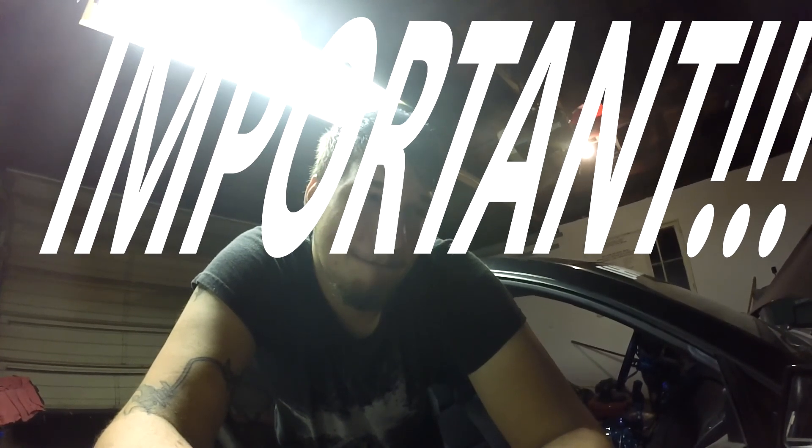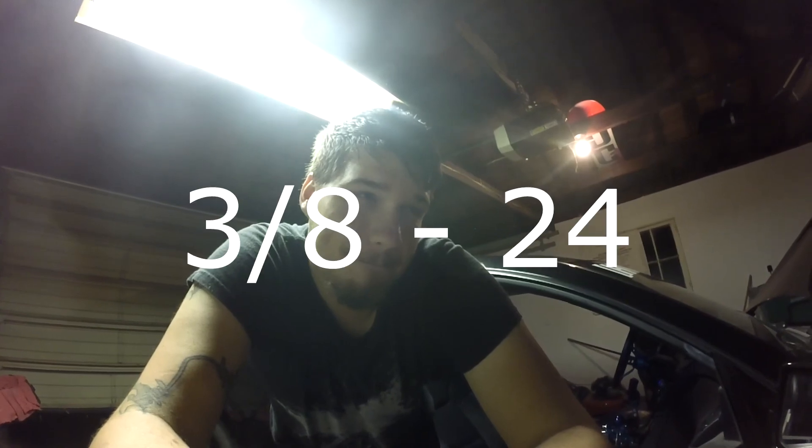The output is standard and the input is in metric. One's metric and the other's fucking American. One's an M10x125 and the other's a 3/8x24.